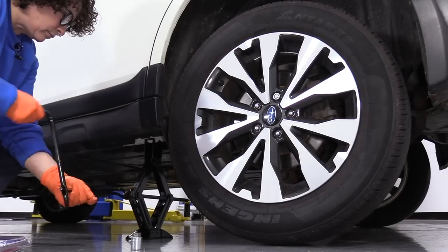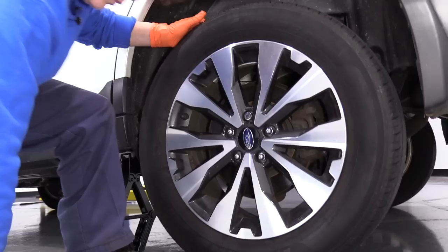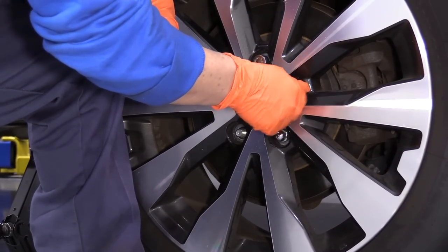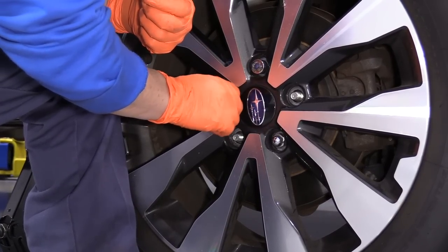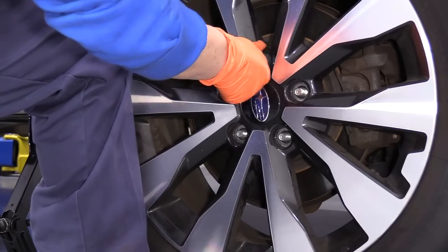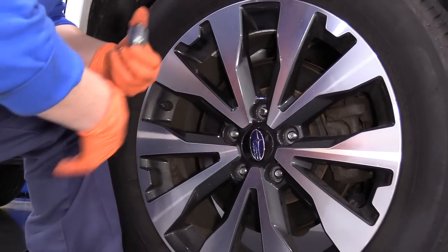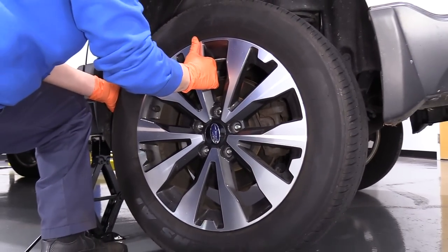With all the lug nuts free to the strength of your hand — make sure they're movable. Don't lose them; put them in your pocket if you need to. Now we're going to jack it all the way up. If you get a chance, look around and see if you can find a rock or a sturdy log or piece of wood — maybe jam it underneath the other side tire in the front and back. Check for clearance. There we go. So now I can by hand take the lug nuts off. I would strongly recommend doing this in your driveway or an empty parking lot so you can feel comfortable doing this under pressure. Loosen the lug nuts before you raise the car. Don't be afraid to move the tire around — it's not dangerous. Make sure you put the lug nuts in a place you're not going to lose them or get them kicked. I'm just going to set them right here. Now you can pull your tire off — grab it from both sides.